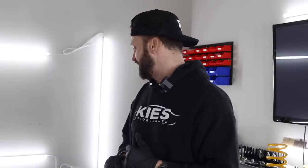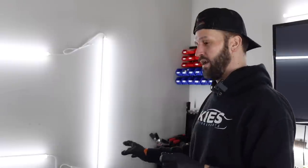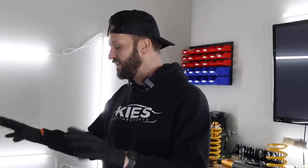The other thing that we wanted to talk about in this video was this strange setup that the person had before me. These have basically non-adjustable camber plates on it already by K-Mac, but they're pretty bent up and beat up. So for now, since I didn't have the perches, I wanted to, one, get everything installed and get the car sort of back on the road.